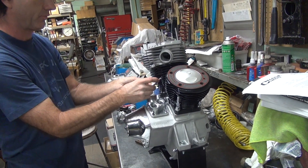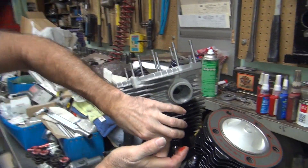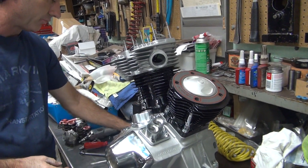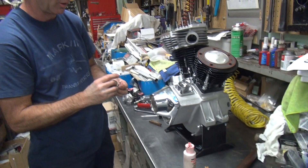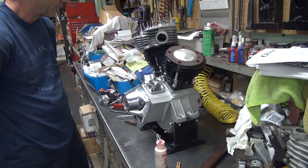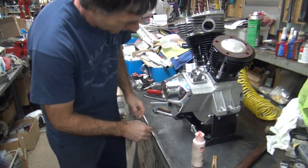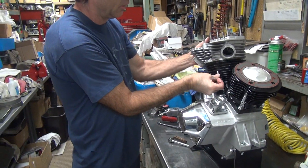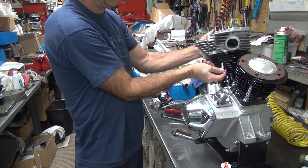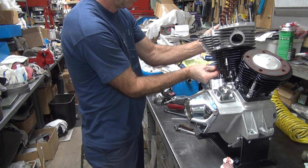What's that? That's lube. That bolt, so it doesn't freeze up. That goes in a hole? Yeah. Don't forget the washer. The problem is I've got lube on my fingers so I can't turn the bolt in. It fell out - fell on top of those nice polished blocks. Don't scratch my motor. Put the rest of that lube on that bolt. Clean your fingers off. What's this? That's the correct size socket - 7/16ths, 12-point. So you'll be able to put it in there. Otherwise it'd be a 9/16ths, 6-point.